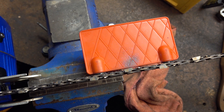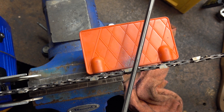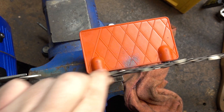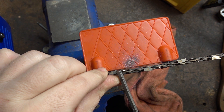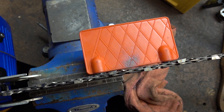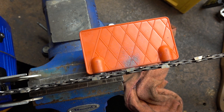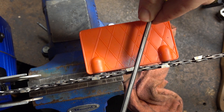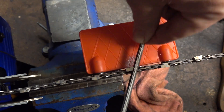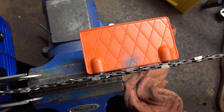This cutter shows it quite well. You can see where the very top edge of this top plate actually started folding over. It's got a little shiny spot out on the corner, and so does this following one — you can see right on the very corner where it's taken some damage. It's not major by any means, just regular use — this chain got used for probably a tank or two of fuel. It's part of the problem with any full chisel chain and why the performance drops off pretty quick, because it doesn't take much damage at all to that outer corner for it to lose its cutting efficiency.